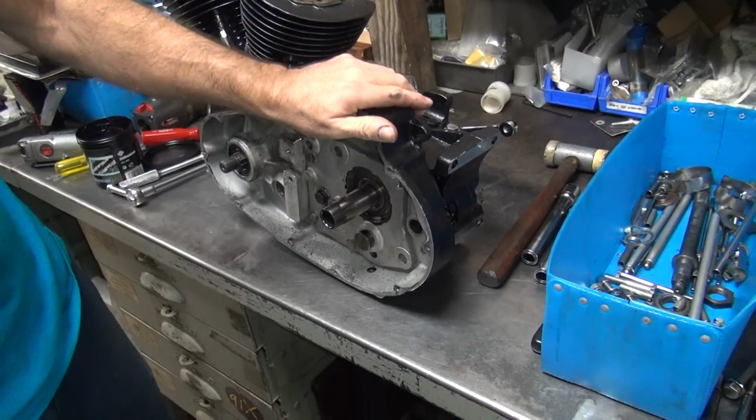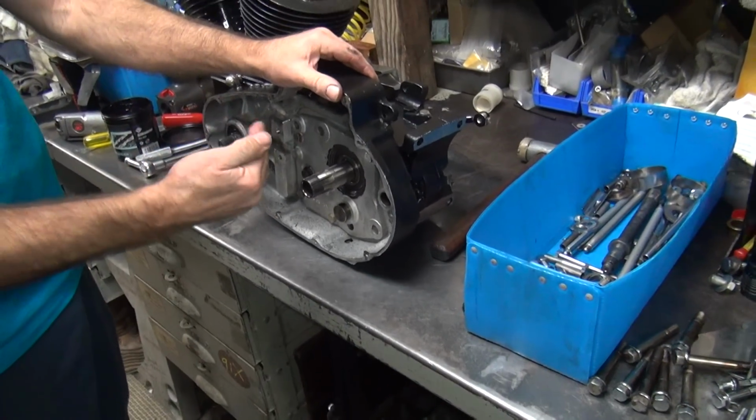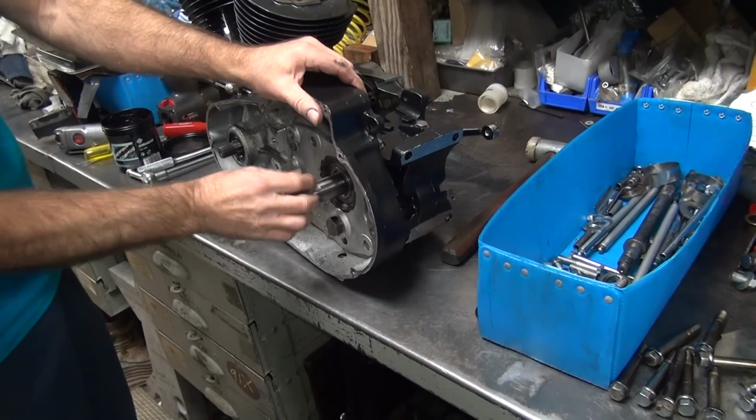So we're negative 5 thou right now. We just got to get that nub off the end there. We have to take off about 10 to 15 thou so we have a little clearance, because we can't have it like that. It's going to be tight and it just doesn't shift very well. But we do have clearances in here.